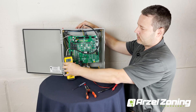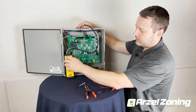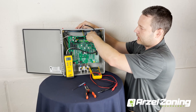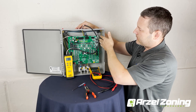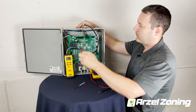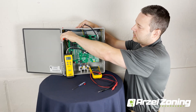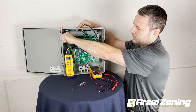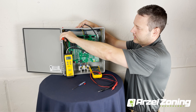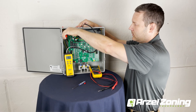To figure out if it's a solenoid, we know that each of our solenoids is supposed to be under vacuum — that's the black and blue stripe line running across the top. Our pressure line is going to be the black and yellow stripe. Since they're all supposed to be under vacuum, we're going to pinch the black and yellow stripe line inside the panel one at a time and see if our manometer pressure changes at all. We'll pinch each of our solenoids one at a time.